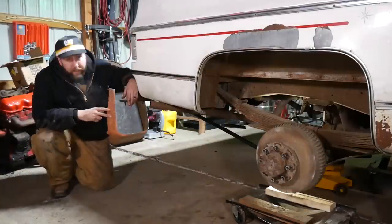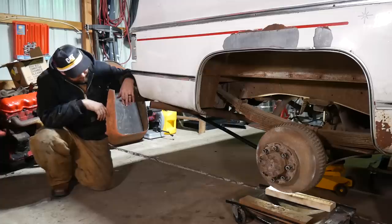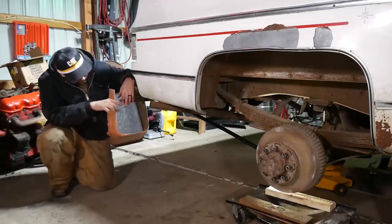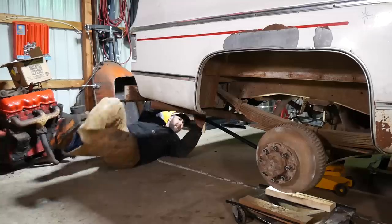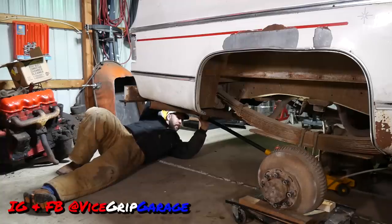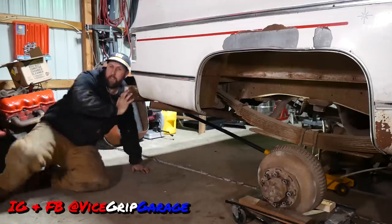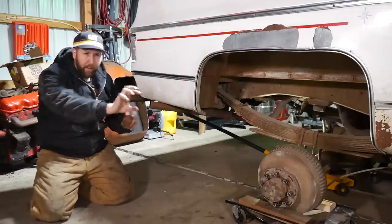Really easy. So I'm thinking if a guy takes the other U-bolts off, she's gonna get a little wobbly on that jack. And there's about a 98.37% chance that, you know, it's gonna fall and crush stuff. So I'm gonna do nothing for safety. But what I will do is lower this side down into this coaster here so a guy can move around easier. Here we go. Easy, slower down. Slow. There we go. Right there. A little bit more. There. Now, kind of set the same thing up on the other side, and then after a guy can just wheel her out of here.